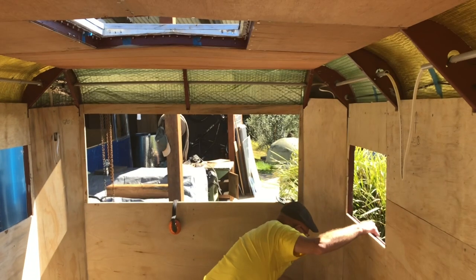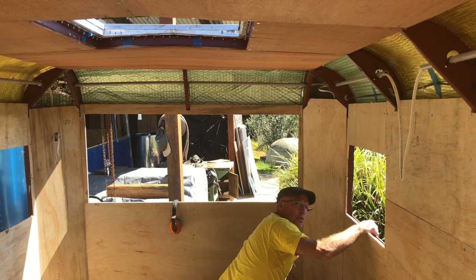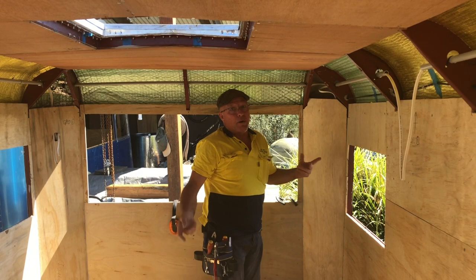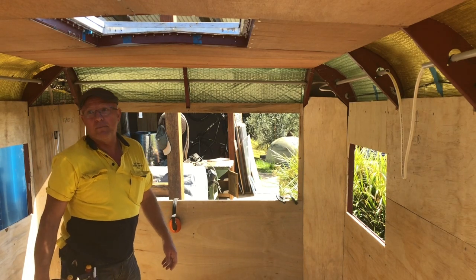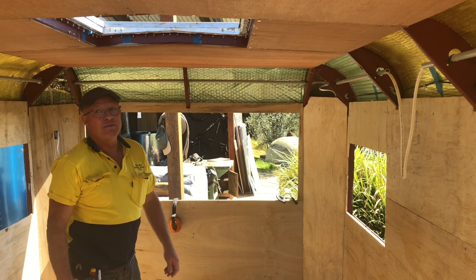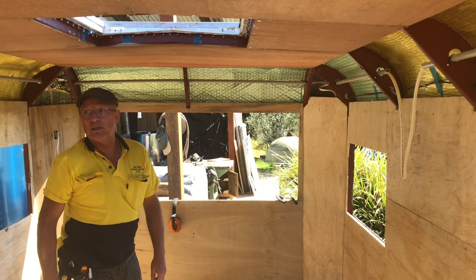What are the key things you've got to watch out for? Vibration, because the caravan's moving, so that's why we're trying to support all the cables. The double-poled switches in both lines, live and neutral, so you're breaking both lines, for safety. 12 volt and 240 got to be separated? You can't go through the same holes or same conduits, so it's got to be totally isolated.